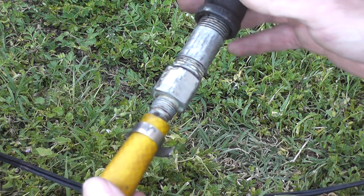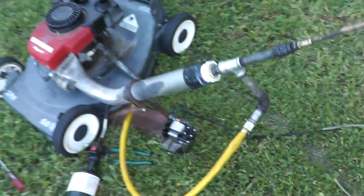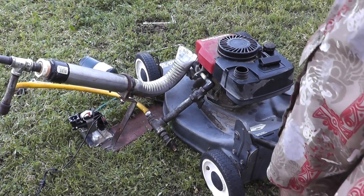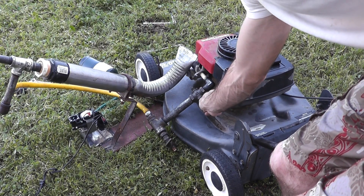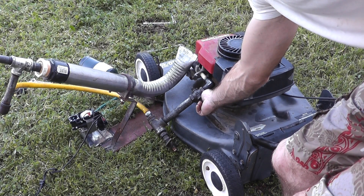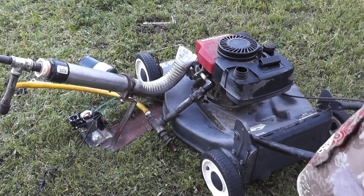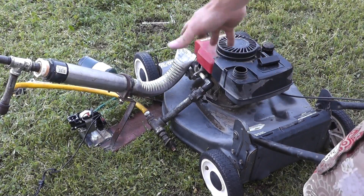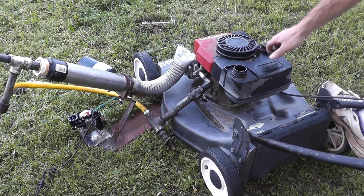So I'll reconnect my line here. I really don't know what mixture this is going to run at, so I'll have my throttle set at just a little bit open, and I'll have the air inlet closed completely to start. If I can't get the engine to turn over at all, then I'll start opening up the airway a little bit to try to find that sweet spot for combustion. So I'll just give it a pull and see what it does.